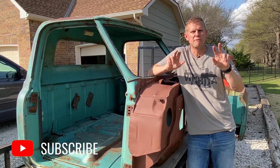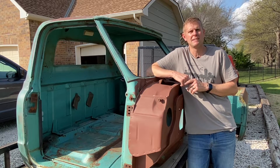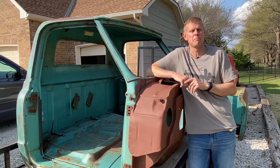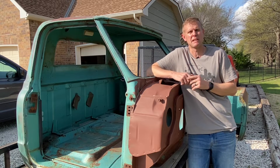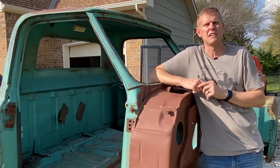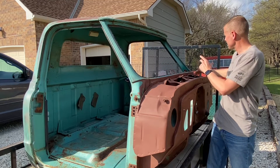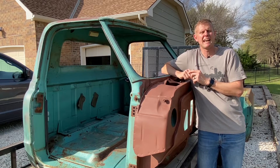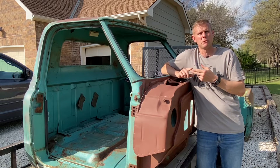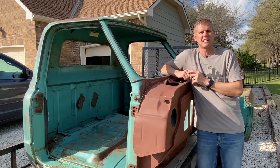Now that we're finished up with this wiring, let's actually go through and remove one of these motors from the truck. The first option I'm going to show you is the best option — why? Because it's the easiest. If you're restoring your truck and have it completely blown to pieces, this would be the time to change the motor out. Even if your pump still works, I'd still think about replacing it for a newer one now so you don't run into problems down the road. If you have your outer cowl panel off or your instrument cluster out, this is going to be a pretty easy task. First, grab your smartphone and take a picture of the inner cowl so you can see how the transmission arms mount to the rotating arm of the motor and how the clip was installed. Then jump inside the cab and take a picture of all the wiring and how the plugs went into the motor and pump. That way when you go to put it all back together, you won't have to guess — it'll save you a lot of headache.